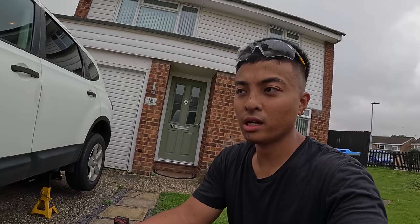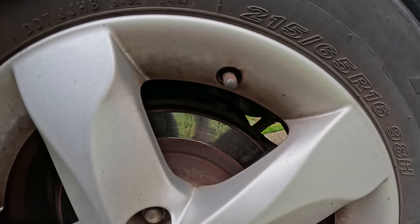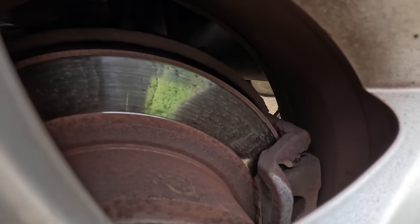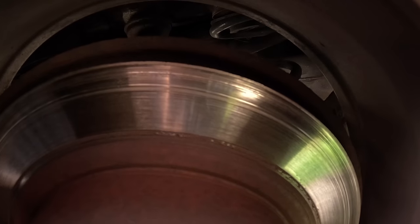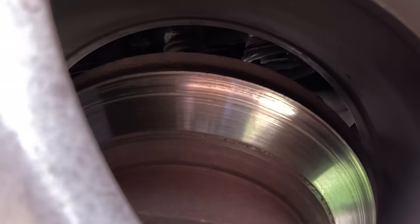We've just done both fronts — now we're moving on to the rear. I think this might be the squeak, because if you have a look at the disc it's perfectly fine, no scoring, obviously the lipping is there, but the pads are definitely wearing thin. Look at that — that is not a good sign. It looks like it's metal to metal.